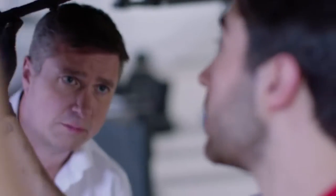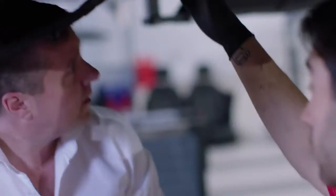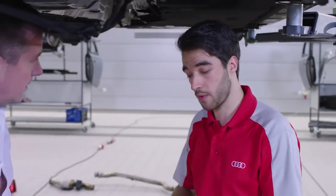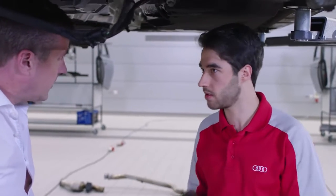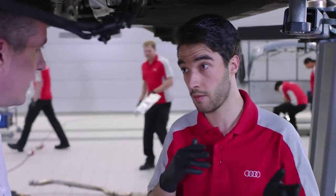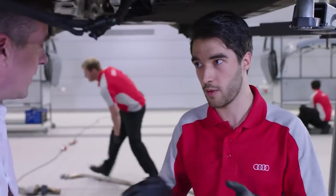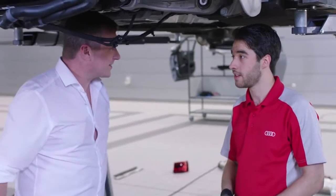And the Quattro system — computerized? Partially mechanical, partially computerized. So you've got your centre diff. When it detects slip on either side, rather than sending all the power to the wheel with no grip, it sends the power to the wheel with the most grip. You've also got traction control through your ABS — once it detects slip, it can brake those wheels. And you've got sensors that detect forward, rearward, sideward, and twist motion. So if it does get a bit hairy, it will straighten it out and keep you in a straight line.